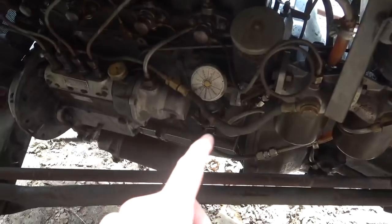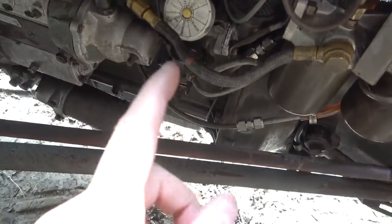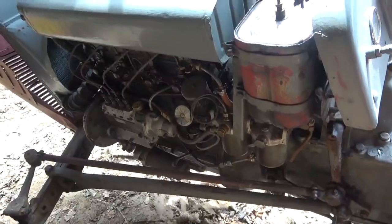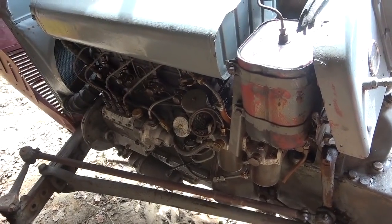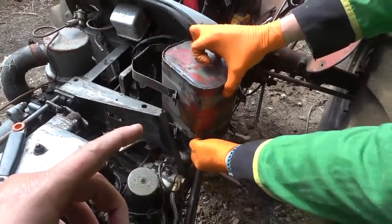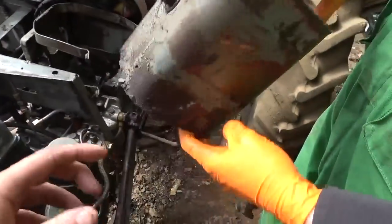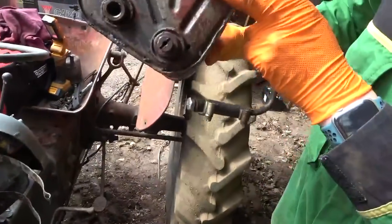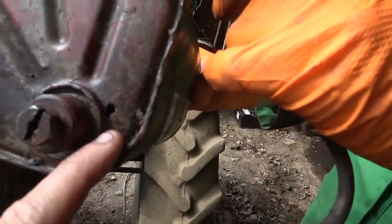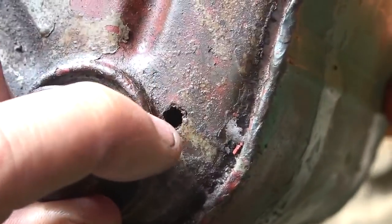We want the auxiliary tank working so that it goes that way, then through the filters and the lift pump — which I suspect needs rebuilding. We've got a rebuild kit and we'll plumb it all back up how it was originally when it left the factory. We've got the main tank off now, and we can get this auxiliary tank off. As we said, the bottom is rotten out on it — give a look at the bottom. Yeah, there's an actual hole in it. That's dealt — there's a hole there.